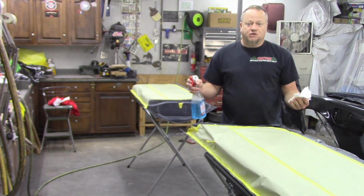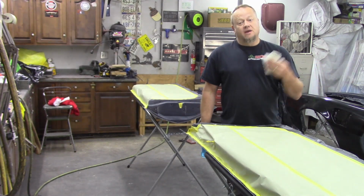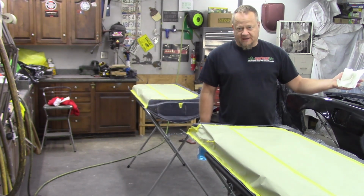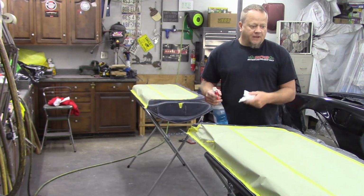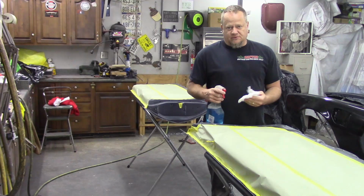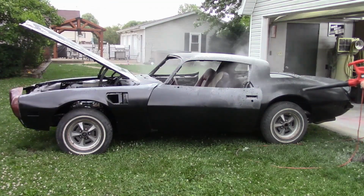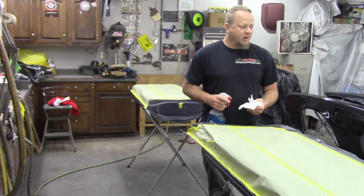As far as the garage prep goes, you see I hang some plastic on some things, mostly because I don't want the overspray to get on them, not so much to keep the dust down. So I just blow my garage out really good. I use my air nozzle for my compressor and spray off my bench and all the parts and pieces, and then I use a leaf blower to just blow all the dust out. And I take a good 15-20 minutes just blowing the dust out every time I spray.